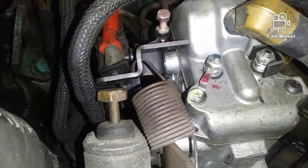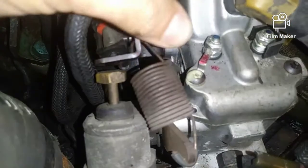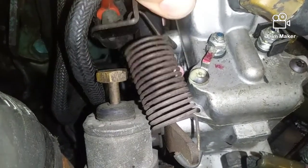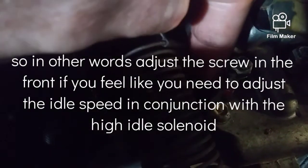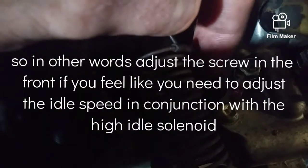I also want to touch on the spring. If you lose your throttle and it's flopping all over the place, check the spring — everything does eventually break. There are two screws here: the screw further back controls how high your engine revs, and there's a simple little screw for idle — if you think it's idling too low, you can adjust that up or down. I suggest referring to the owner's manual for what the manufacturer recommends.